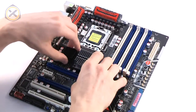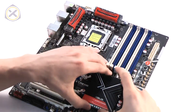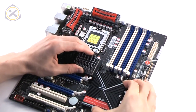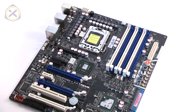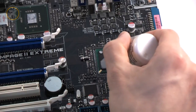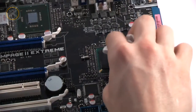You'll need some patience to remove the heatsink off of the north and south bridge. Apply pressure as evenly as possible and slowly separate the board from the heatsink. This task is a bit easier if the heatsink is warmed up, since this softens the adhesive thermal grease underneath. Now the residue of the thermal grease needs to be cleaned off of the north and south bridge chips. I recommend using ArctiClean or a similar cleaning agent, since otherwise the adhesive grease can prove to be very tough to remove.